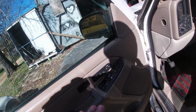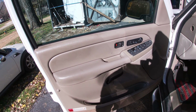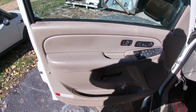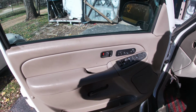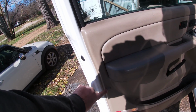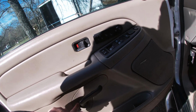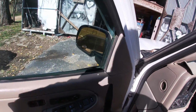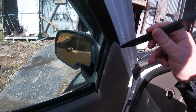So step number one is gonna be to pull this door panel. GM was pretty wild with this one. They basically just had a bunch of hodgepodge fasteners, it seems like, and they just made them all work. So let's go ahead and uncover all of these fasteners. So you got one behind this little tab here, right? You got one behind this little panel here. You got to get this off. So you're going to want a trim stick. If you don't have one, there will be links in the description, and a push pin puller.